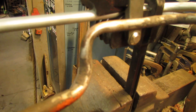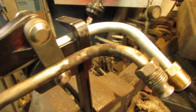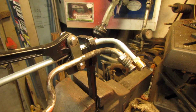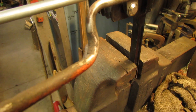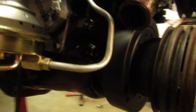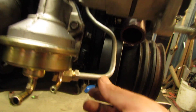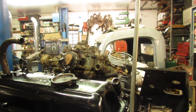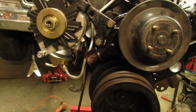I'm going to start the 90 a little before where it is on the original one because I've gotten a little long right there. After each bend I'll take it and test fit it to make sure it's still going to work out okay - obviously I can't make a bend that tight either. Here's what we got so far. I'm going to have to do a little tweaking right there to get back straight but keep it far enough away from the block that it's not going to rub. Once these fittings are started and in the carburetor you can tweak it a little bit - that's been my experience.